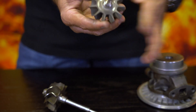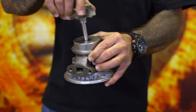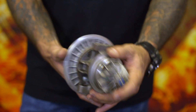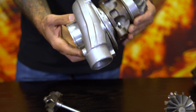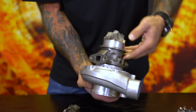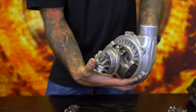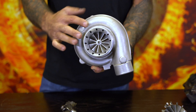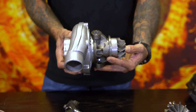So this should fit into here — just want to line everything up, everything is loose. Shaft goes in. Let's assemble this. Forget about the housing or the name of the housing — what turbo do we have here now? It's got a genuine Garrett T3 shaft, and the rest is Chinese with a bullet compressor. So what exactly is this? I can tell you what it's not — it's not a genuine Garrett. Period.